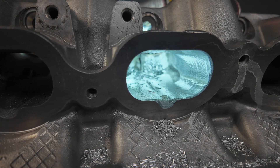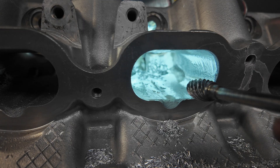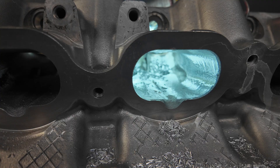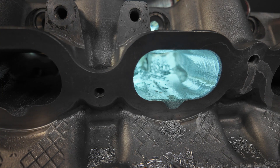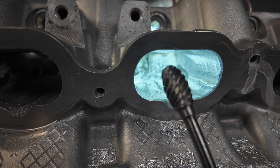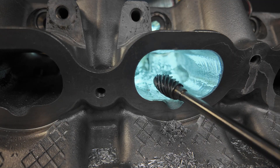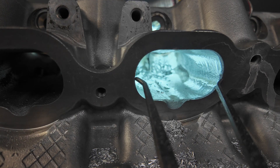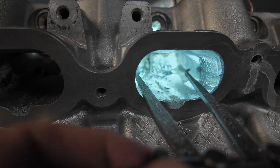We are roughed in. I don't usually show this part. You'll see a lot of parts that are not touched — everything in here is rough, there are big boulders and stuff. Change is really hard in the beginning, messy in the middle, and beautiful in the end — and that's what we're going to have here. I'm going to switch to the Head Games Half-Inch Super Spiral burr. This burr is what's going to blend everything in, make it nice, sandable and no big bumps. We're also going to do some measuring to make sure the port is to the size I'm looking for.